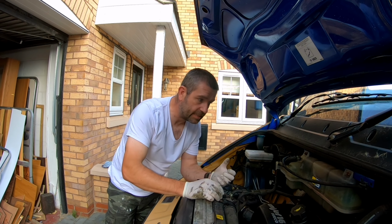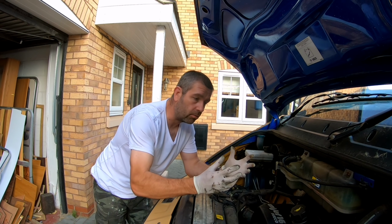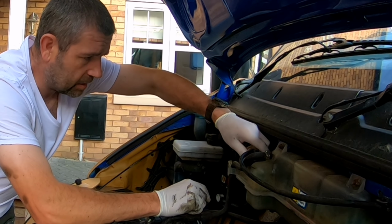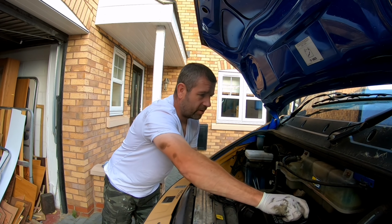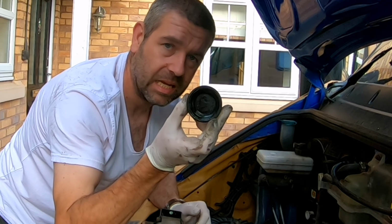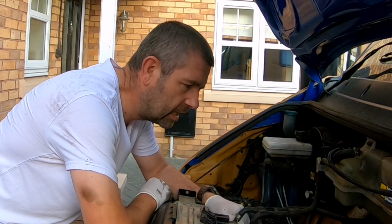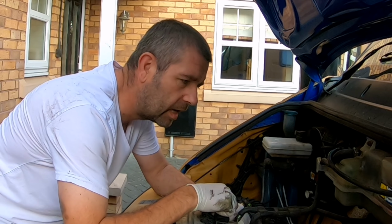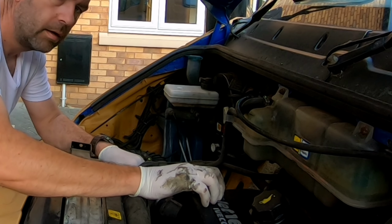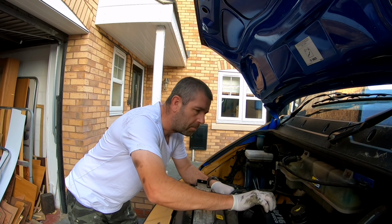I'm not going mad, it is happening when the engine's warming up, so something's expanding and letting the oil seep through it. I say it's not the air gasket, because I've just released the pressure on that. Clean. It's got to be the oil wiper seals. I bet they'll have stuck, or the cylinder liner is scored. I think I'm going to go in.